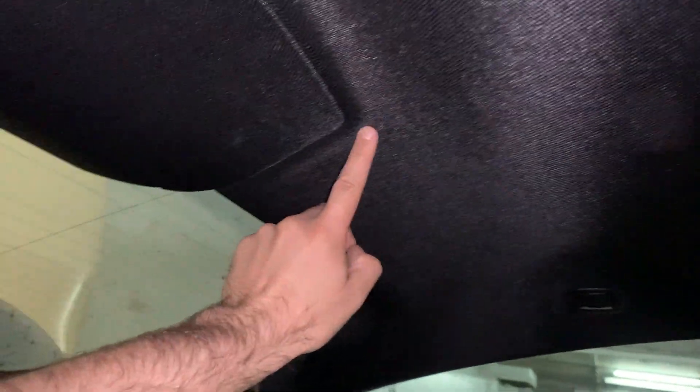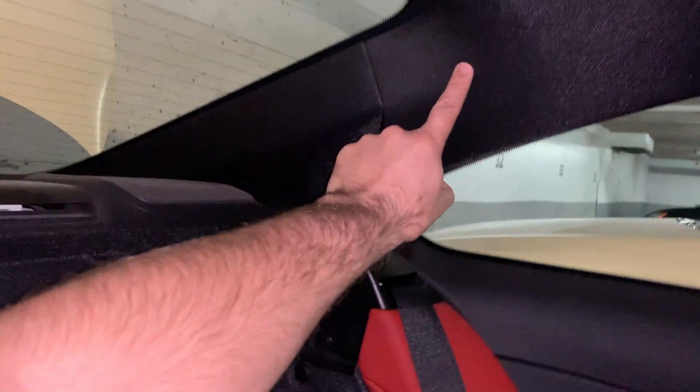Let's go get the antenna — the roof antenna — which is approximately right here. It's gonna come following the wires this way. Then we're gonna have to remove this back trim and continue this way; the loom is somewhere in here. Continue here and finally come to our ATM which is right there. The roof antenna for GPS is located up here, and we can see the antennas for other stuff — this one is for keyless entry, and the shark fin antenna is right there.